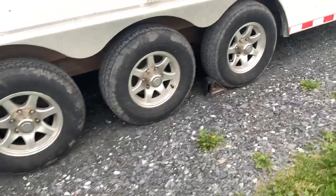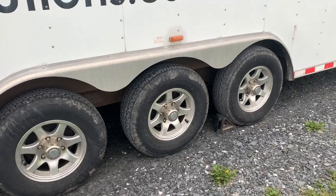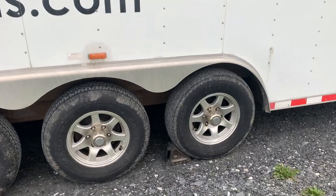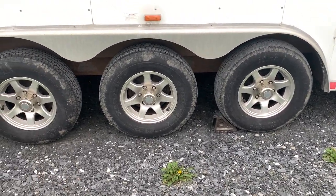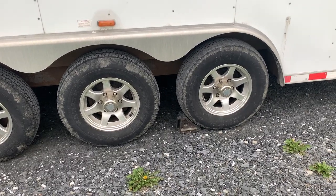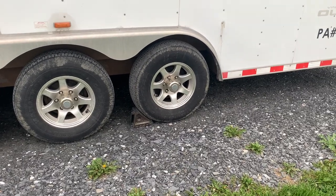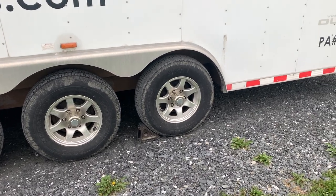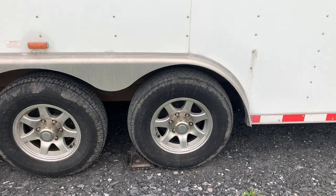Let's do a quick walk around. We have the tri-axle trailer. The huge advantage of this tri-axle is that if and when you blow a tire — and it's inevitable you're going to blow a tire — the rim never hits the ground, because you have two other axles next to it. So on the highway, for example, if you're in cattle chutes in a construction zone, you can still drive slowly out of the zone without damaging your rims, so you can change the tire safely.